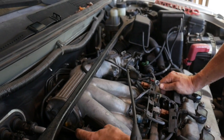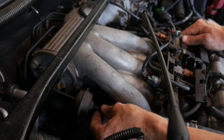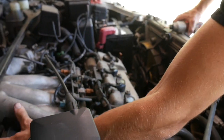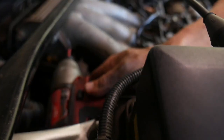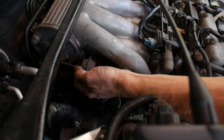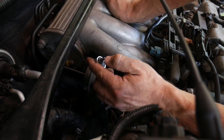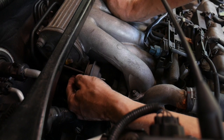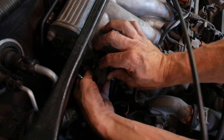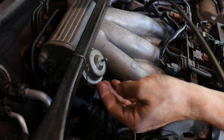On this side I'm going to remove what's like an AC idle controller from the side of the plenum. I'll pull this little vacuum hose off right here, hopefully without breaking it. Now I'm going to get these Phillips screws off — they seem pretty tight so I'll try to get an impact on this. Since I can't get my impact down on the bottom screw, I'm going to use a Phillips wrench. It's actually a number three — the bigger Phillips — so don't strip it out. Alright, I'm just going to wire that up to this crossbar.